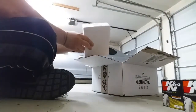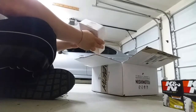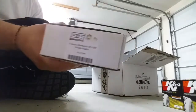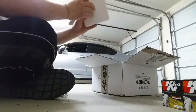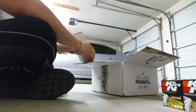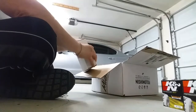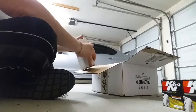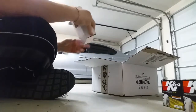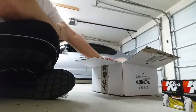This is your Grimspeed aftermarket downpipe to OEM adapter. This is crucial when you get an aftermarket downpipe, no matter what kind you get, because it goes from three inches to two and a half OEM. You want to prevent leaks, so this is actually a great adapter to have for everybody that's modifying their vehicle.